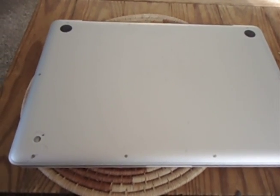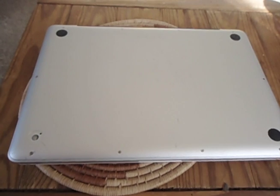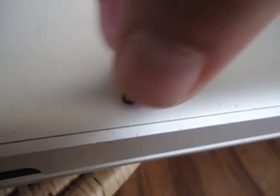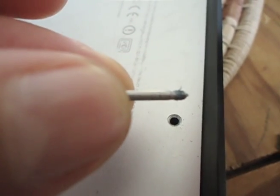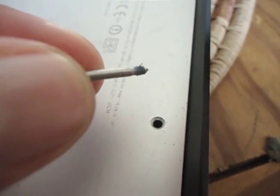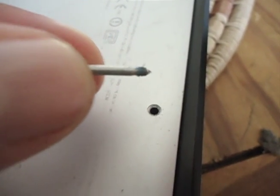Okay, so open the case — just remove the screws with the Phillips head screwdriver. Ideally there are ten of them, or in the case your MacBook isn't in great shape like this one, some may have already fallen out. You're going to take out eight to ten screws. You'll notice there are a few screws near the hinge that are a little bit longer — just make a note of where they go. Alright, that was easy. Now you're a genius — an Apple genius.